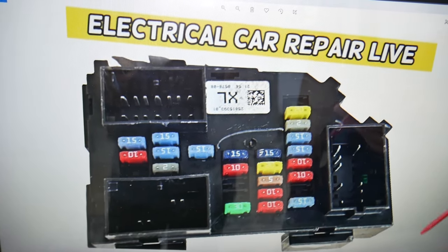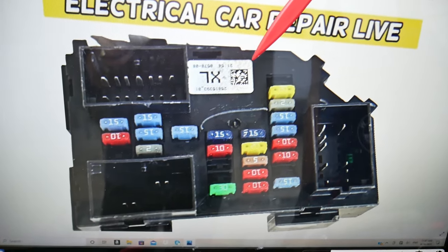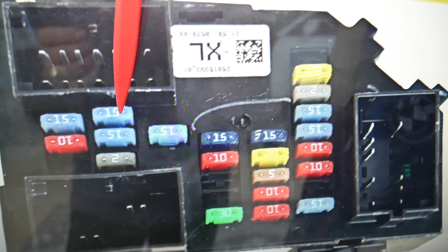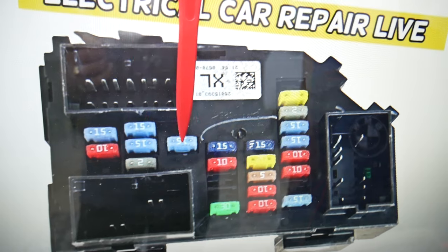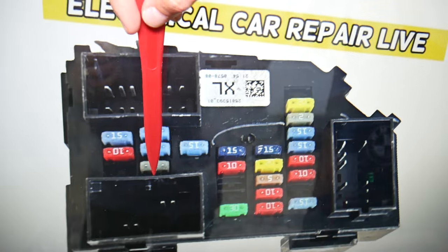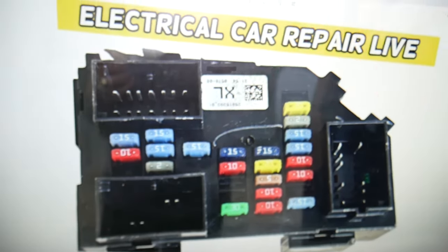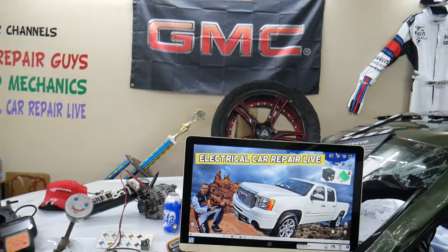Here for the dome light, we start here. If you have a missing fuse you count that spot — that's fuse one, then two, three, four, five. Fuse number five will need to be checked right here. Then you go to six, seven, eight, nine, ten, eleven, twelve, thirteen, fourteen, fifteen, sixteen, seventeen. Fuse number 17 is the fuse you will also need to check — that's a 10-amp fuse. So fuse number five and fuse number 17. Hopefully the video is helpful — thank you for watching, see you next time.